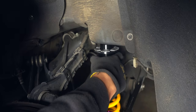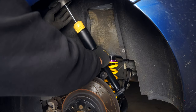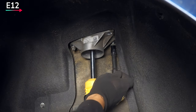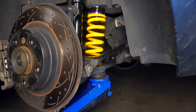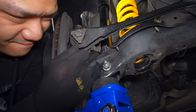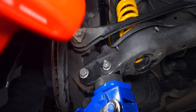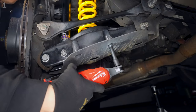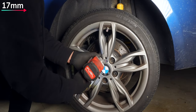Personally, I can say that an 18 by 8.5 inch wheel with a 35 offset on up to a 245-35 tire does not need any additional modifications in the rear. On rear-wheel-drive cars, running wider wheels in the back is no problem. But for xDrive cars, you'll want to make sure that the overall diameter of the front and rear tires are within 1% of each other. To help figure this out, I'll leave a link to a tire size calculator in the description. Staying within this 1% range will ensure that all four wheels rotate at the same pace and prevent damage to the transfer case. But if you prefer a longer tire lifespan over looks, running the same size tire and wheel would be best.